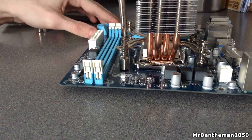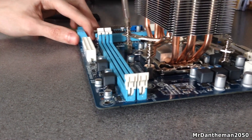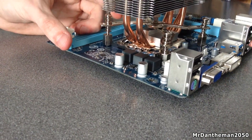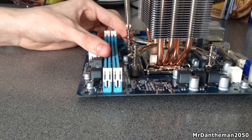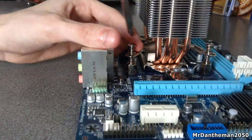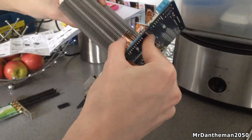As you remember earlier, the thermal paste is between the actual CPU and the heatsink, so that's there as another layer to dissipate the heat. Just tightening these up — you just literally want to do it a small amount at a time until it won't screw anymore. And there we are — voila, that's it. You should be able to pick it up by the heatsink and if it doesn't move anywhere, you have installed it correctly.